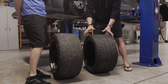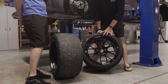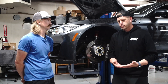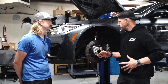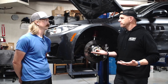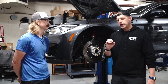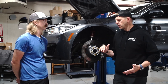What we actually have on these cars is a 315 Continental on an 18x11 TA16 forged wheel. We've had our Bimmerworld TA5Rs, we've had the Motorsport wheels — all of those fit on the front of this car now. So this is our GT Moore suspension package, probably the ultimate ultra-premium option. This is the suspension for a track guy that wants the best, or if you're racing, no-brainer — this is what you want on the car.